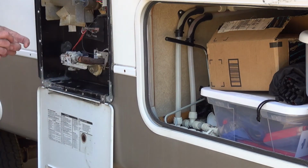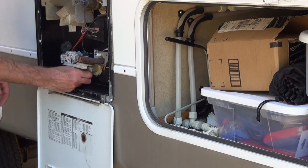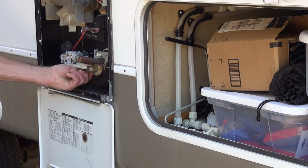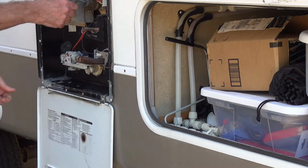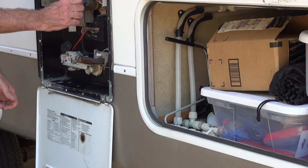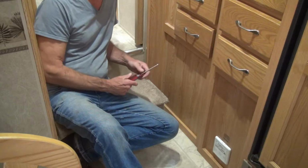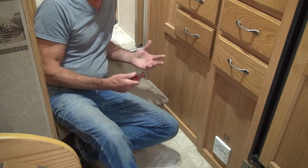I take my plug and I'll put it in, and I'll only hand tighten it, to tell you the truth, for this. I'll probably get a little antifreeze leaking out, but there's a valve on the inside that's not supposed to let water come into this anyways, so really shouldn't have that problem. My system has, I think, another valve for complete closure; it seems to cut off one end. Hard to explain. Okay, so now we are going to put the antifreeze fluid into the system.